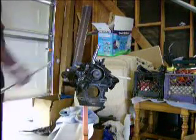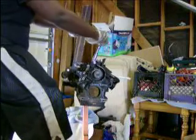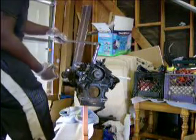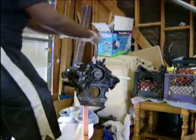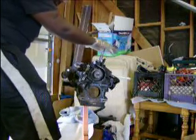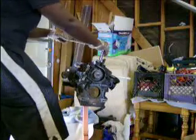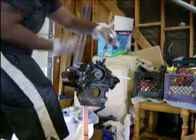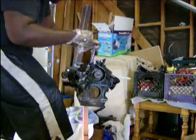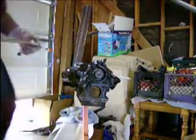Breaker bar. These two are already loose — I started doing this without videoing it, and I figured there are people who are going to want to see. So now I'm videoing it. These two are already loose on number two. Number three I'll just show you guys. These don't really matter as much as the main bearings. You can pretty much take these on — it's not very hard when you have a breaker bar. I suggest getting one if you don't have one; it makes life a hell of a lot easier.